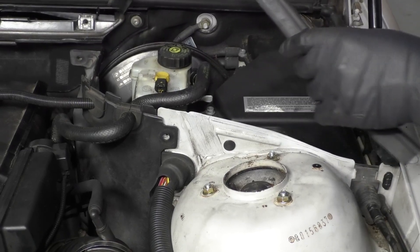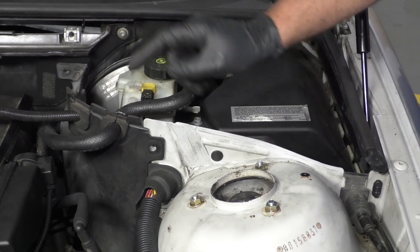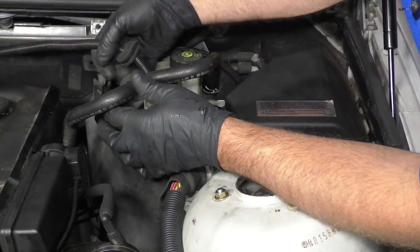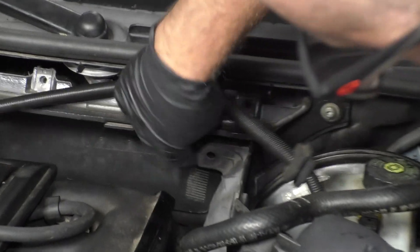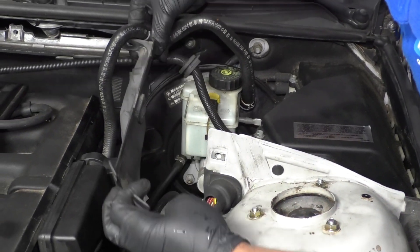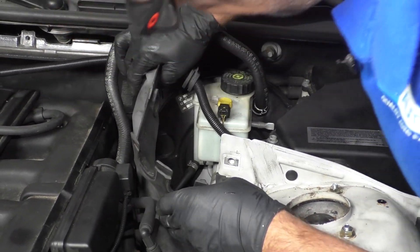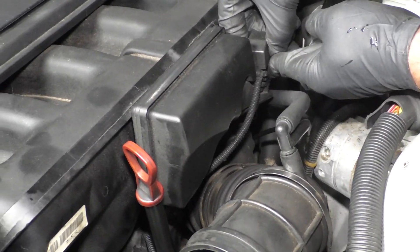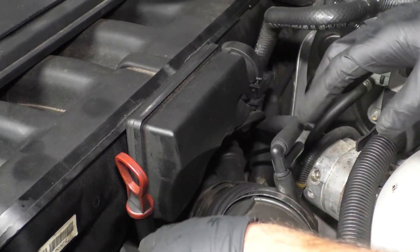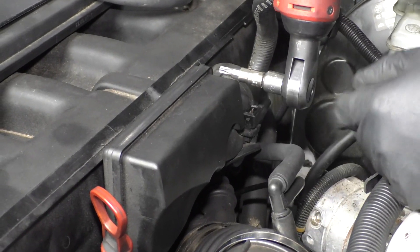I'm just going to take this weather strip off and slide it up. There's a retainer right here — slide this retainer out, and then slide these hoses off here in the wiring. You should be able to slide this up. You might have something holding this in near the firewall, but this vehicle doesn't have that. Then just sneak it past the hose and slide it out. Disconnect this connector right here — there's a little push retainer right there. Slide that off.